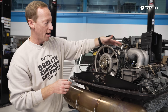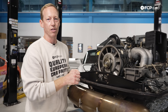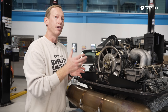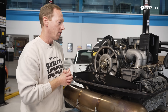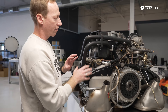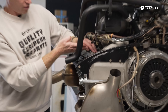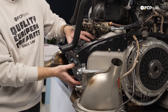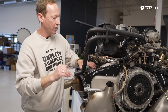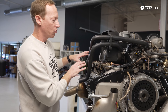If you're noticing that your shroud or your engine tins are damaged, you may have to do a little bit of searching to find exactly the right thing for your car, because there are some variations from year to year, engine to engine. Once airflow gets sucked in through this fan and put through the shroud, it goes to the engine cover shroud made of plastic and is pushed down across the cylinder heads — which, when uncovered, basically look like a motorcycle cylinder head with a bunch of individual fins, helping to cool those cylinders.